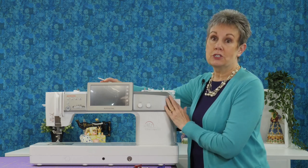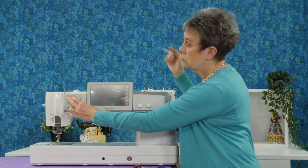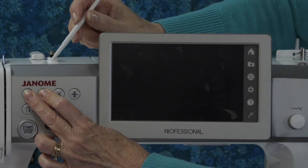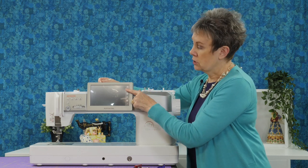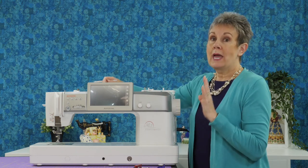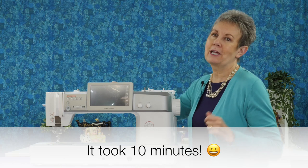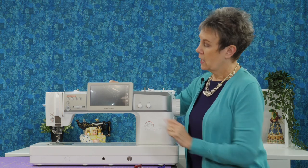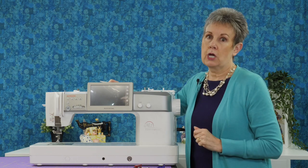First thing: machine is off. There are two buttons you need to hold — the lock stitch button and the needle up/down button, both at the same time. Press them in and then turn the machine on, making sure you're still holding those two buttons until the display screen turns yellow, at which point you can release them. When it's doing its update, you'll see a blue line at the top that will eventually fill the whole screen with blue, and it will say 'finish' when it's all done. While it's updating, don't do anything — don't take out the USB stick, don't turn the machine off. You can go have a cup of coffee — it'll take a few minutes. When it says 'finish', turn the machine off, take out the USB stick, and we'll double check to make sure the update was successful.